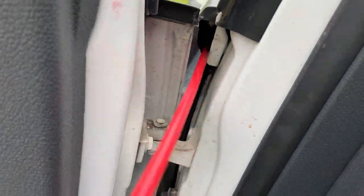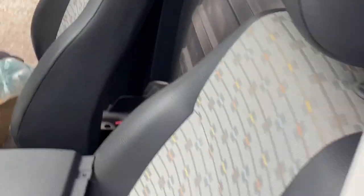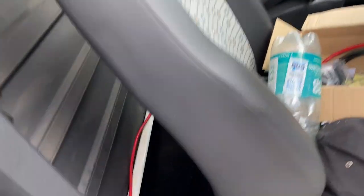I've pulled the wire through and it worked great. Now I'm going to route the wire so that it's not resting on any metal edges, then poke it through the bung so I can get access to it on the inside of the car. This is looking pretty neat — the cable runs down here, I've yet to tuck it fully under, and it goes behind the seats, leaving me with the cable end ready to connect.